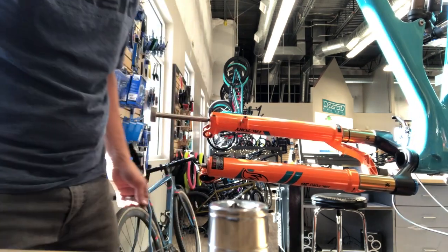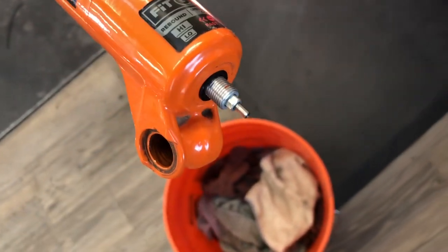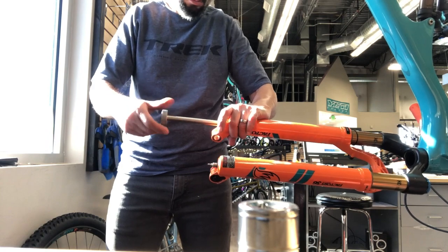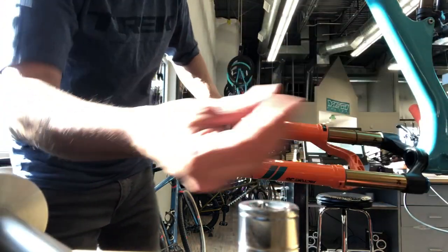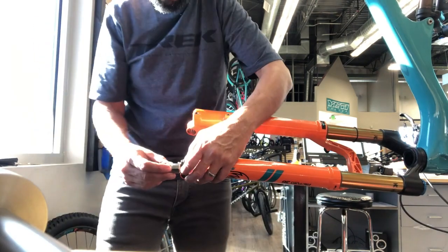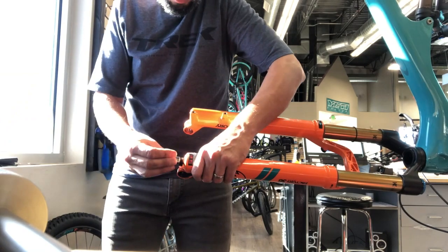Once you extend it all the way you could hear the air equalize. Gradually let out a little at a time until the air shaft is pretty neutral — maybe sticking out a couple inches and you can move it easily — then remove the clip that holds the air shaft in. I had the lower removal tool for one side, but for the damper side I just used a 15 millimeter socket. Ideally use a six-point socket, not a 12-point, so it doesn't mar up that aluminum nut.